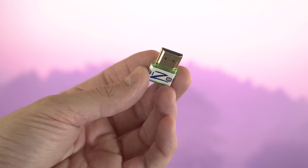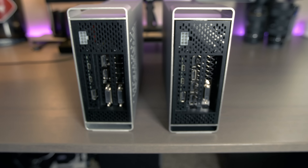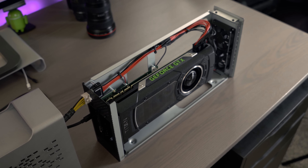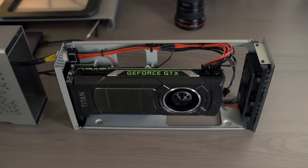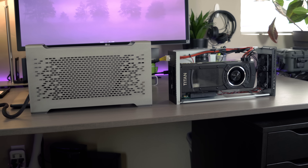One thing to know before running any tests: the Bison Box 3 will need an external monitor connected to recognize the eGPU and take advantage of its acceleration. However, Bison Tech also sells a headless HDMI accelerator, which essentially tricks macOS into thinking there is a display connected to the GPU. This is a picture output limitation of macOS — it only sees dedicated GPUs if running through an external monitor. This is not a limitation of the Bison Box 3. In Windows, it sees the eGPU regardless of whether a display is connected. Also, if your applications support GPU selection — such as Adobe Creative Cloud and Final Cut Pro X — you just need to make sure the appropriate GPU is selected when you start a project.